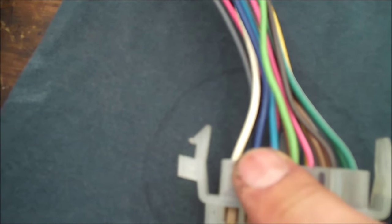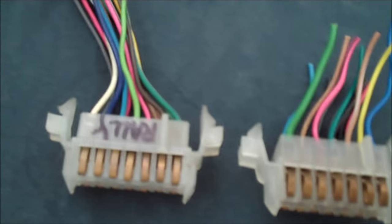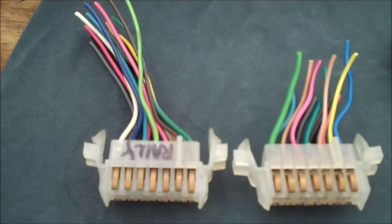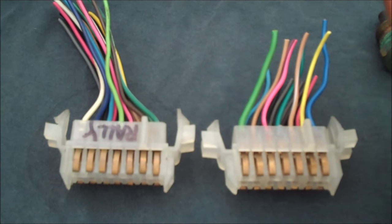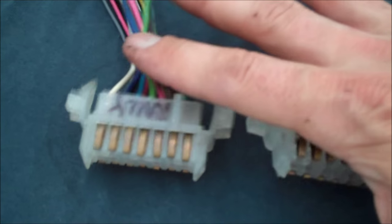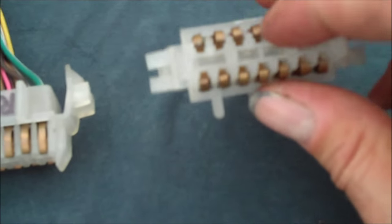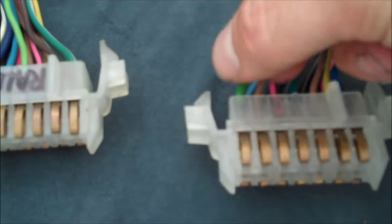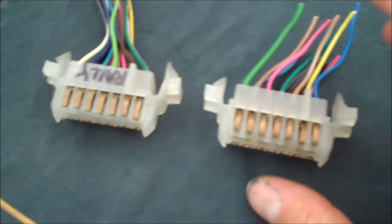This white wire is for the tachometer. The standard plug does not have it — it has a green wire in its place for something else in the standard cluster. I will put a picture on the video you can pause to see exactly what each one of these ports mean. I'll also link other websites that have complete electrical configurations on how these plugs are configured. To convert your standard plug into a rally plug, you take a small screwdriver, release the tension on the clips, pull the wire out of the back of the plug, and stick it in the correct slot. Each port is numbered, so the image will show you what color wire goes into what number port.